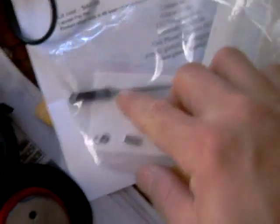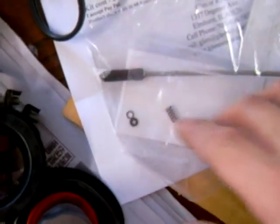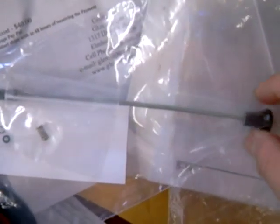What's nice about this kit is that it comes with this adjustment screw that mounts on, plus the O-ring, washer, spring, and everything. This rod is so long that after you mount your motorcycle, you could make your fuel adjustments easily from the outside.